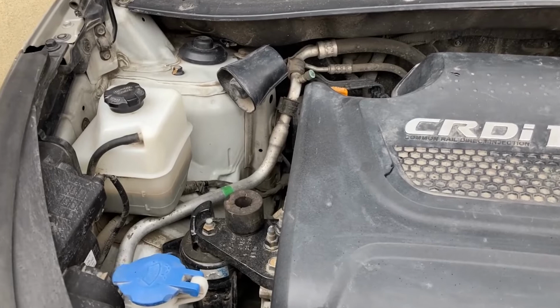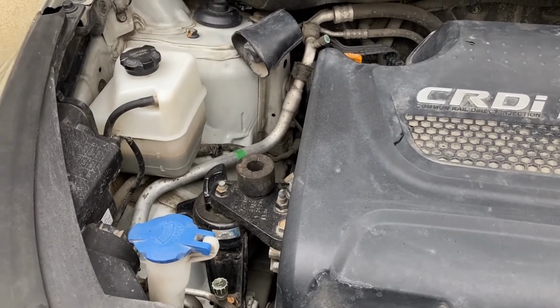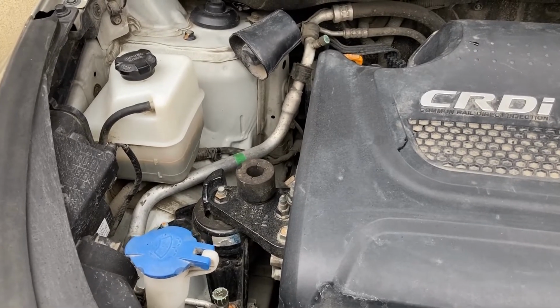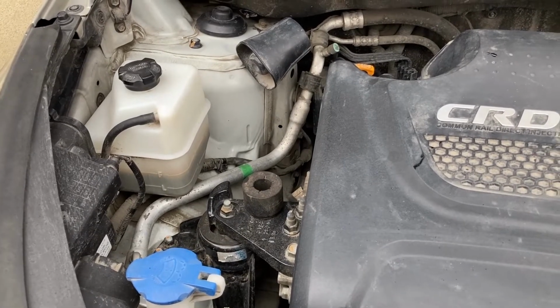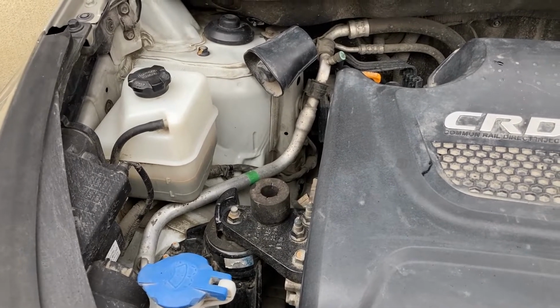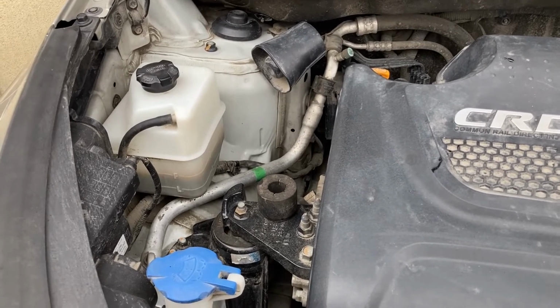And with the coolant reservoir, I actually want to touch on an interesting subject. If you happen to take a look at the coolant flush for the Corsa, you'll notice that the Corsa's coolant reservoir has two pipes, one at the top, one at the bottom. And it's conceptually quite simple what they do, right? The one at the top flows into the reservoir, and the one at the bottom pulls coolant from the reservoir as the system needs it.